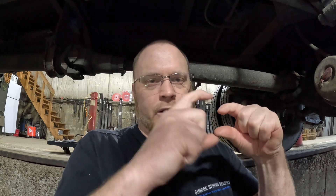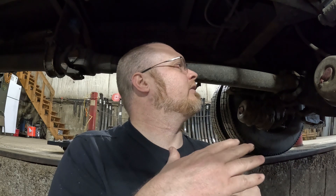There are two different spacer types — a one-inch thick one and a one-and-a-half-inch thick one. Some don't have spacers at all and go straight onto the axle seat. Some have a U-bolt plate or a torque rod plate. There are so many different ways they make these suspensions, so just check it all out. Make sure everything is nice and flat, square, and even — when you tighten it, you don't want to bend the spring around it. The spring is strong and hard, and with all that preload, he'll do his next trip and split the spring in half. Take it apart and check it all out.